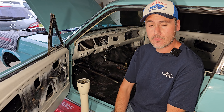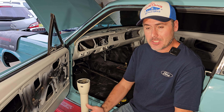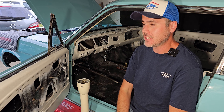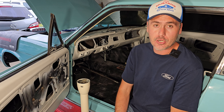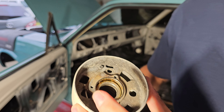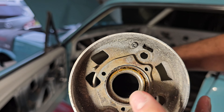This piece right here is part of the column — the steering wheel goes on top of this. This piece goes into the pipe. If you check other videos about the power steering conversion kit installation, especially from CJPony Parts, they have a really good video where they set all this on a table with the shaft inside and the other shaft on the other side, trying to assemble everything on the table to have an idea where the cut is going to be. But in my case the shaft is already in the car — I tried to remove it to do that demonstration on a table.